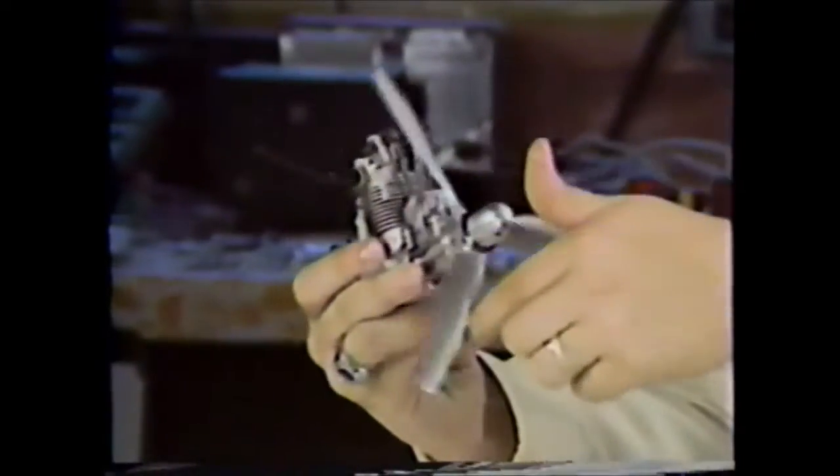Now, I have a kind of an odd prop on this engine, and thereby hangs another tale. This prop is a Grish Brothers 3-blade 8-8. Now, an 8-8 is a weird prop. There can't be a whole lot of applications for an 8-8 prop. But this little engine hums along beautifully on it. For some reason or other, this just happens to like that extra pitch. And generally speaking, the extra torque that a four-stroke engine produces means that you can use wider, deeper pitched props. Scale modelers love it because it comes closer to looking like the real thing.